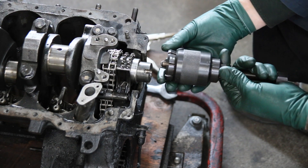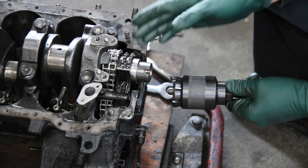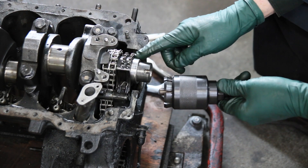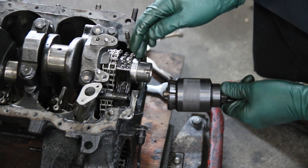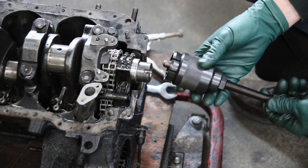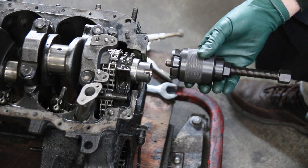Because it's really narrow right there, it gets in underneath the chain — that's been the problem with other pullers. There's a chain that comes up and drives the oil pump here, so you can't just put a normal puller back there; it's going to hit the chain. That's why that's such a small, sharp edge. And then this long bolt — you just turn that in once you clamp the race, and you can take it right off.